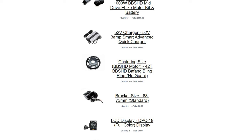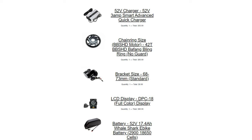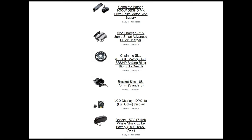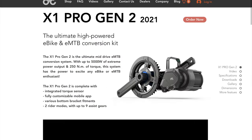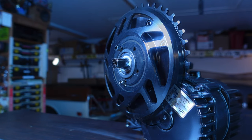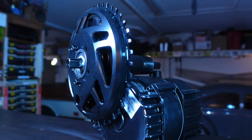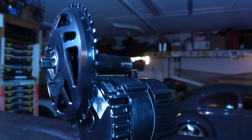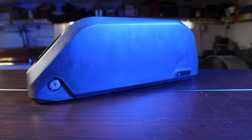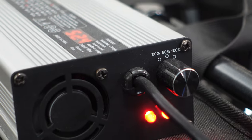I did a bunch of research on mid-drive conversion kits and settled on the Bafang 1000W BBSHD kit from eBike Essentials. This is the exact kit I purchased for a total cost of $1,637. I did look at the CYC motor kit, but ruled it out due to excessive drivetrain noise. The Envoy has a 73mm bottom bracket, and the 42-tooth bling ring provides the best chainline. This is the largest 52-volt battery that will fit in the medium Envoy frame, and I went with the upgraded charger, which allows you to select a maximum charge percentage to help increase battery longevity.